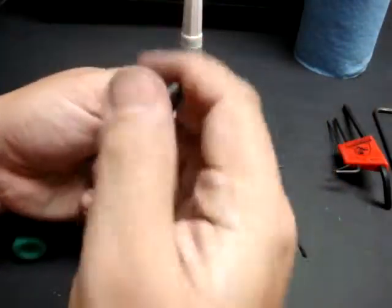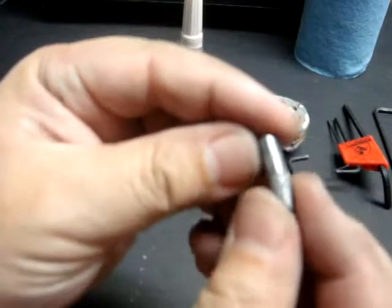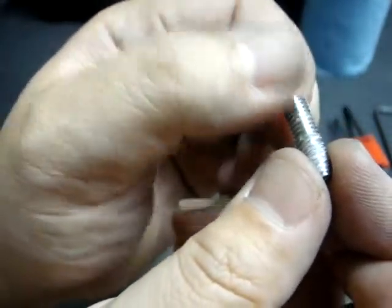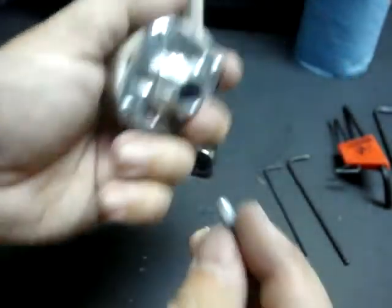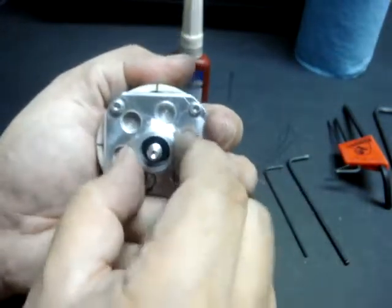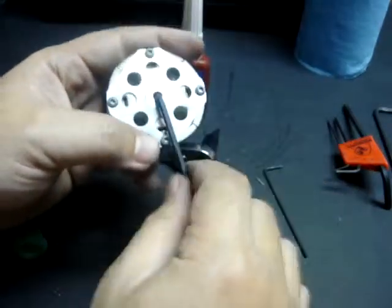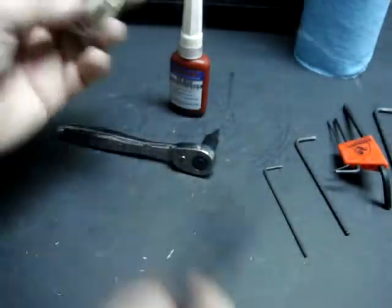It's a little bit loose now. Alright, it just comes out the other side. I'm going to give this a good inspection. The threads look very healthy, so even though the RC has taken a lot of bumps, tumbles, and hits, the threads were never damaged. I'm going to clean that off — that's just dried-up threadlock. To put this screw back in, just simply twist it into this hole right here on this side of the Elcon clutch body, in this billet machined piece, and turn it back in the opposite direction until it's tight. I'm doing that loosely right now because I want to clean off the old threadlock before I put on new threadlock and put this back into the housing.